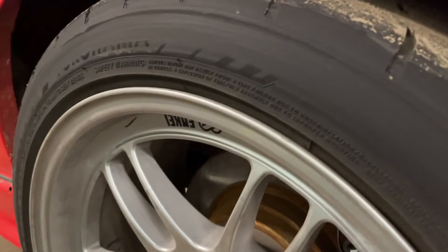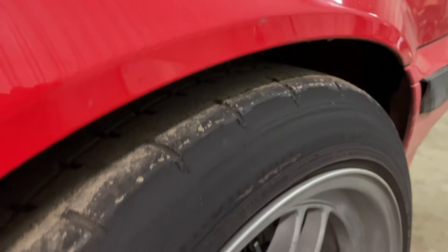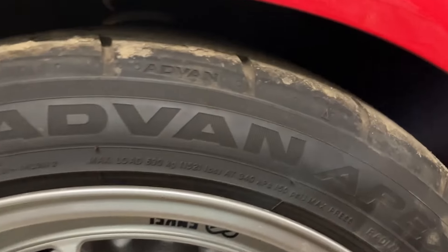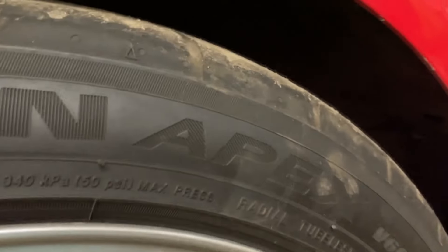Here's one of the big problems I have with the current spring setup. As you can see when it's rolling over during cornering, it's pretty much deleting the entire sidewall and just rubbing away. Here's what it's supposed to look like — nice lettering, sidewalls all there.